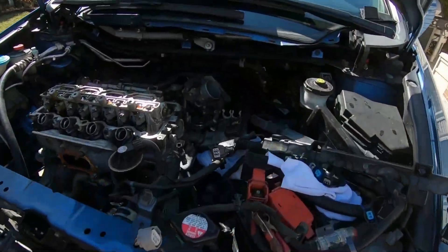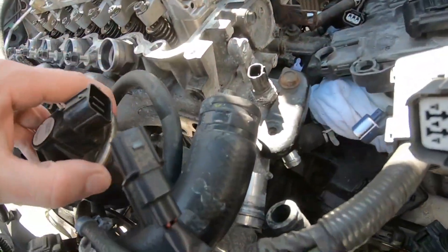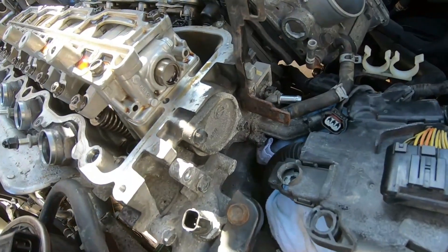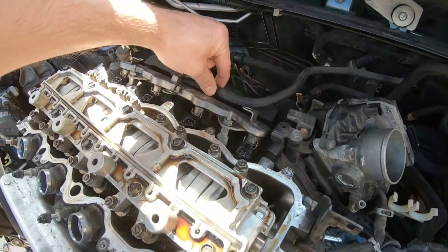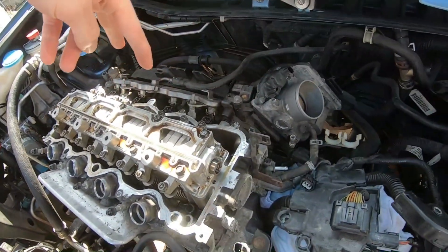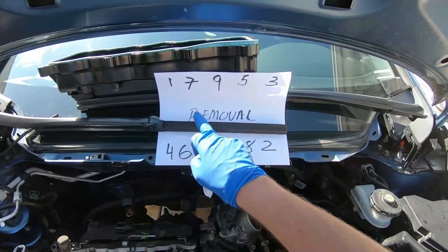So we're pretty much ready to unhook everything. The fuel line I believe is the only thing that is still holding on. Everything else looks good. There's one coolant hose here but that's actually connected to this EGR system, so it is disconnected. I may have to disconnect this bracket right over here to get this off. There are like two wires that are still holding on — that's the starter wires — but that's on the block and it's under the intake manifold that I cannot reach. I'm gonna start taking off the head bolts here — this is the removal sequence.